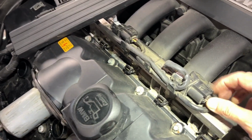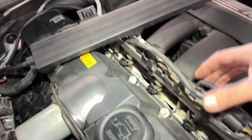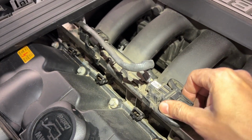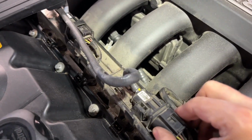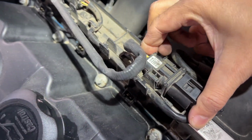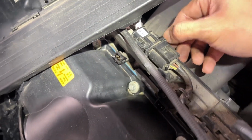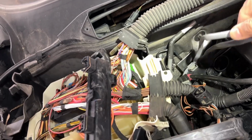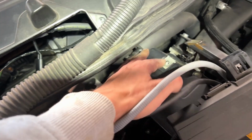So we're gonna move these cables out of the way as well. Just disconnect from here, 2 cables. You can just pull it out. Inside, you just need to little bit use the flat screwdriver to pull this away, and same on this one, so these will be out of the way as well. And from here, release these cables. Okay, because now in that way we'll have access on those 3 bolts in the back.